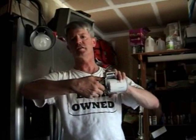Okay, here's the oil filter, the new one, just to show you in simulation. There's a lot of different kinds of oil filter wrenches, but the one I have is too big. Here's the size of it. So what I do is I took a socket to take up some room, and then when I turn it to loosen, it pinches in here, and it actually works quite well. So this is my poor man's oil filter wrench. So we're going to use that. Also, this goes in here.